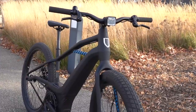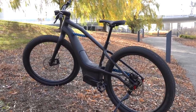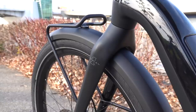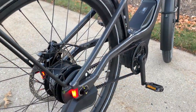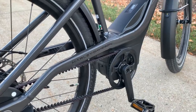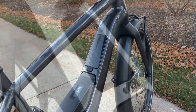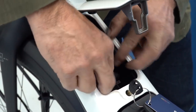Serial One has two major frame designs: the Mosh, which is a single-speed and something of an urban playbike, and the Rush, which uses an automatic Enviolo NuVinci continuously variable transmission and is more outfitted as a commuter e-bike with full fenders, front and rear rack, etc. Both bikes share a lot in common — they're equipped with Gates Belt Drive systems, powered by Brose Drive S-Mag Mid-Drive motors, and have swappable batteries housed very low in the frame to improve mass centralization and lower their center of gravity. They all even have a glove box that can hold a high-security ABUS folding lock, which can be keyed alike so you can use the same key for battery removal, the glove box lock, and the bike lock. Why have three keys when one key can do everything?